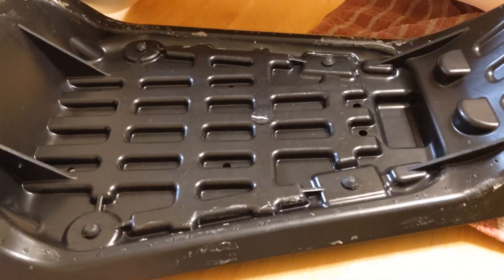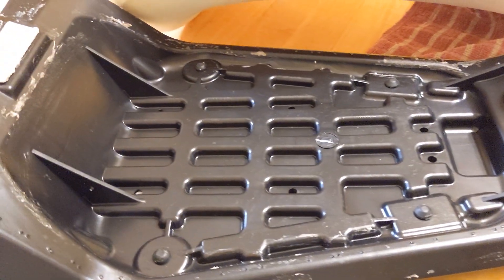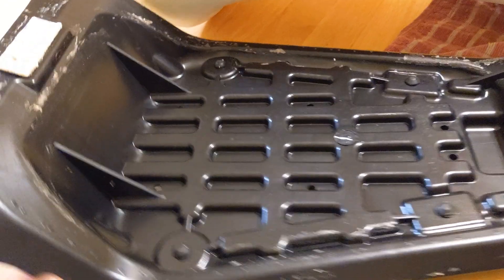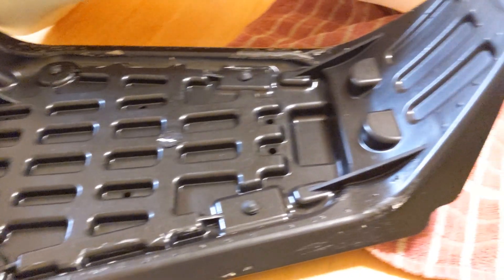That's what the seat pan looks like on its own. Next step: clean it with contact cleaner — that's the same in my mind as brake cleaner. I'm gonna clean it all up, look for any sharp edges, sand them down, make sure no broken staple legs are in it, and then I'll come back.